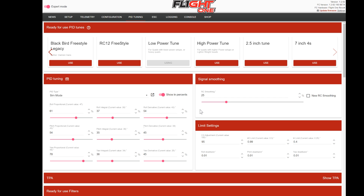If I still hear a chirp, that means maybe my quad is super powerful and I would try the high power tune. I'm going to find whichever of these three tunes works the best and use that going forward - I'm probably not even going to touch the PIDs, although I might do some fine tuning. In general, one of these three tunes has worked on just about every quad I've ever tried, but there are some other tunes in there too if you want to try them.